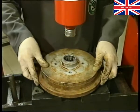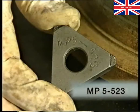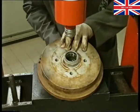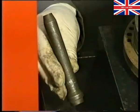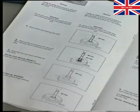If either bearing requires replacement, use the special tools to remove and refit the bearing rings. If replacing only the inner bearing, you will need to use the special tool MP5-523 in conjunction with a suitable workshop tool. The recall bulletin describes all the special tools required and how best to use them.